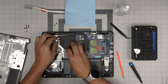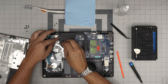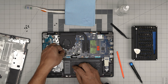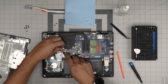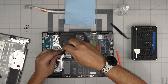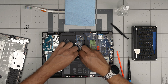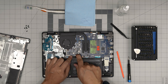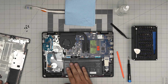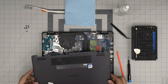Put the fan back underneath and push down the fan connector. Bring the LCD cable all the way around — it has a small earlobe on the side, so bring it down at a 45-degree angle into the jack, making sure the earlobes are seated inside, then close the latch. Put the two screws back on the fan. To finish, reconnect the battery connector evenly in front of the jack and pinch it in. Once you power on, it may take up to 30 seconds to show anything on screen because we disconnected the battery and there's no CMOS battery — just leave it and wait.